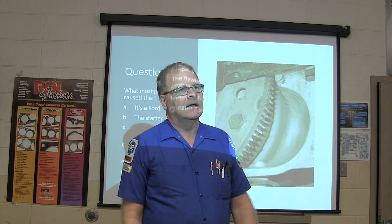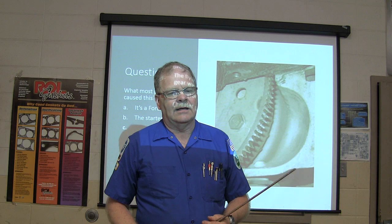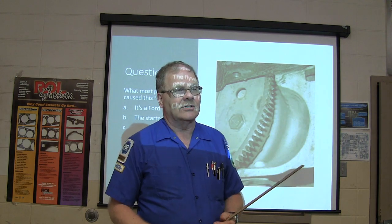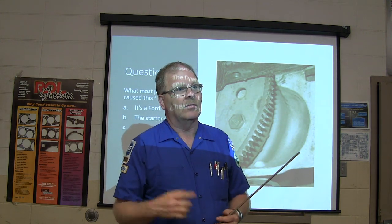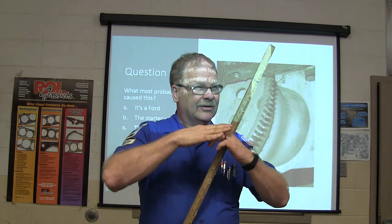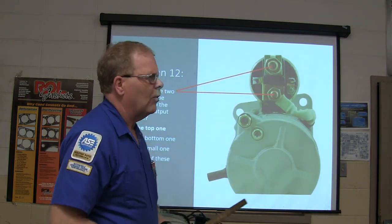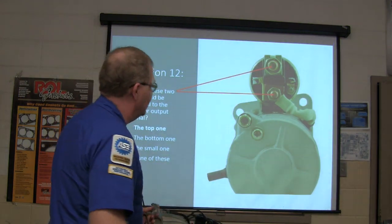And after Bobby Lundy put that thing on, he put a flywheel in it, and it almost immediately started doing it again. So I beveled all the teeth on that flywheel when we put the next one in there, so they'd be opposite the bevel on the starter, and it never did that again. They've been starting it for years now. I don't know why that was necessary, but we were engineering, you know.